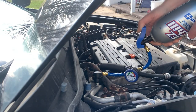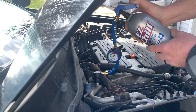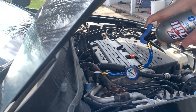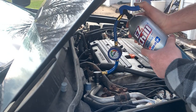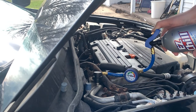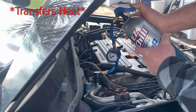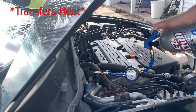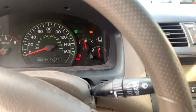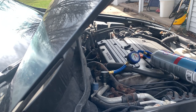I'm not really good at reading directions - I just think I have a better idea. It said to rotate between 12 and 3. The can's getting cold now, so I think it's actually taking the refrigerant. As the bottle empties, the liquid is boiling off because it boils at a much lower temperature, and when it does that it removes heat from the side of the can - it's freezing my hands. Let's go see what that did. It's getting a little cooler - dropped back down but it's coming up. Max filled right there. I want to see what happens when it cycles again.